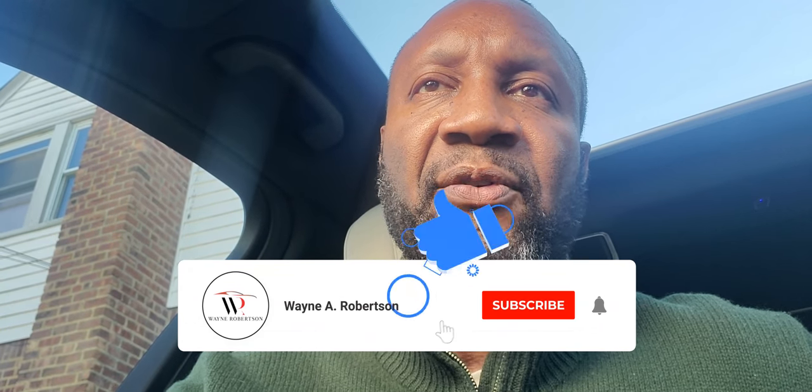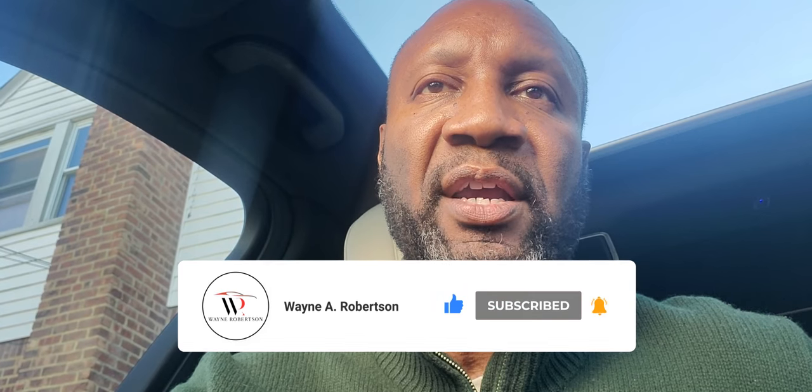I'm going to talk about what happens when that SAM module fails. Some of the things it controls: fuel gauge not working, lights not working, your fuse keeps blowing, keyless entry and key fob don't work, battery drainage, taillight staying on, center dashboard buttons don't work, Mercedes blowing only cold air, windows not working. You also have turn signal, fog light, and fuel gauge issues. If your SAM is failing, you may see several problems that don't seem related.